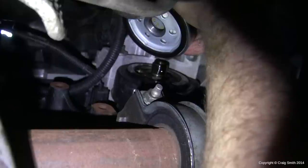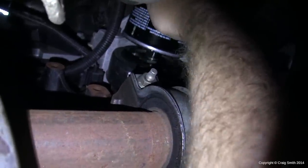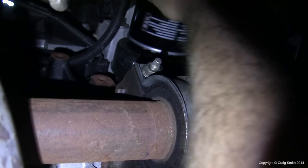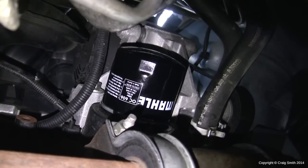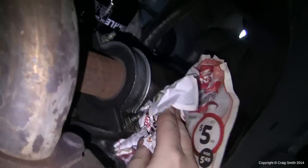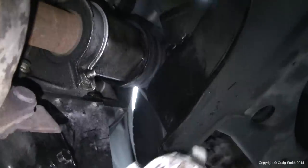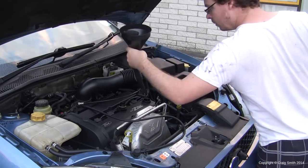We're ready to go ahead and put the new filter on the engine. Slide it up into position and do it up — the thread is on that little spindle in the center. Make very sure that you do not cross the threads or do any damage at this point. It's worth taking your time. Once it's correctly on the threads it should be very easy to do up — it'll just spin itself into place. To tighten it, do not use a tool. You should just be able to tighten it up by hand. Once you've got the drain plug and the new filter back in place, take some newspaper or a rag and clean up the old oil. You want to be able to see any leaks after you've put the new oil in — old oil everywhere makes it really hard to see what's happening.